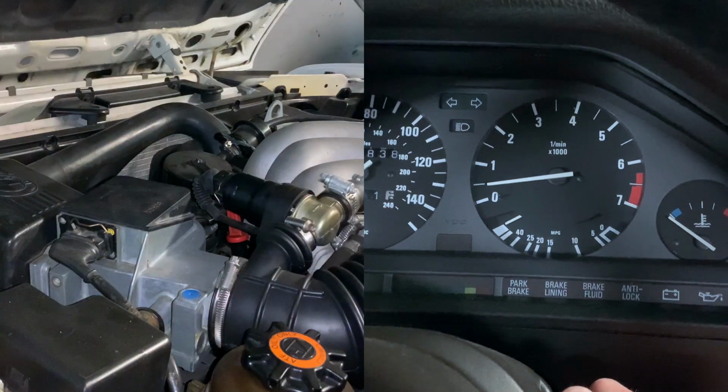Okay, I have to drive slowly because the camera will fall. Okay, so now that the engine has been warmed up, we're going to start the car again. And this should now cause the issue that we talked about earlier, where the rev counter will go up and down, and perhaps most likely stall because it will just drop too low. So we're going to try that and see what happens and see if our test does reveal that the ICV is the problem. Let's try this.